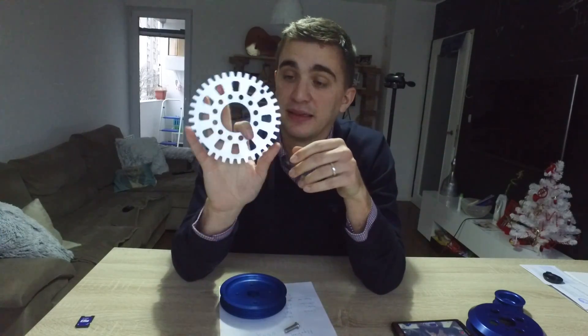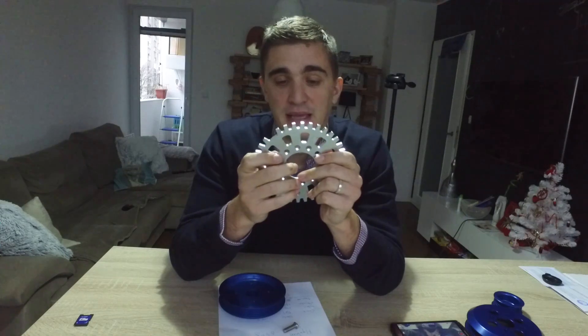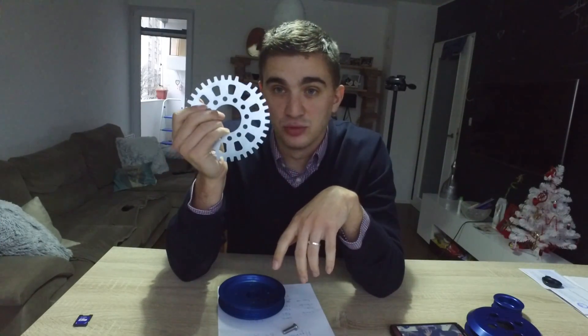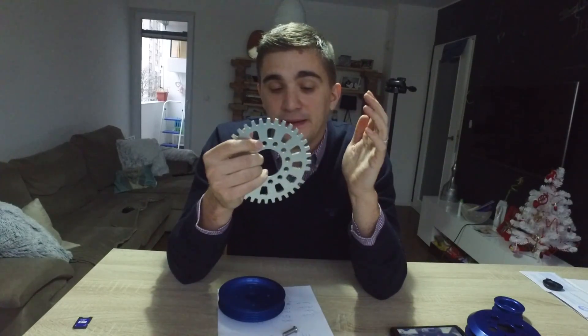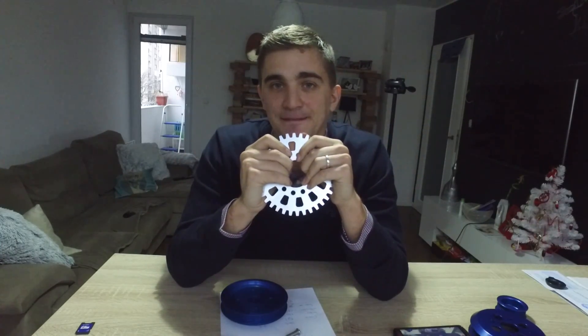This is also anodized or galvanized, so it's probably not going to rust. It's very important because without a good trigger wheel you won't have a proper signal to your crankshaft position sensor, and your carbs will definitely not be running right because your standalone ignition ECU won't be interpreting things as it should.